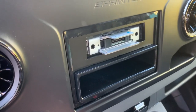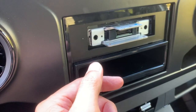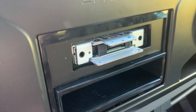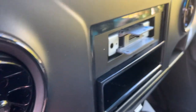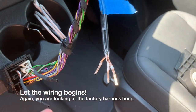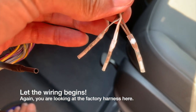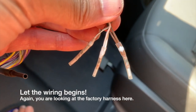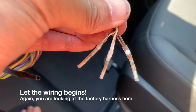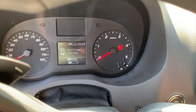This is how it looks with the screen removed — the whole connector piece can slide in and out. I like the screen to be closer to the panel, so I chose the inner position, but you can let it stick out more if you prefer. Now for the SOS wire — connect the corresponding colors together and seal them. That takes care of the microphone for the SOS system. I'll still be using the factory microphone for the SOS. After bundling them up and turning the car on, the SOS warning light should no longer be on — and it's not.